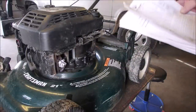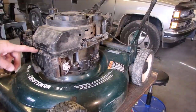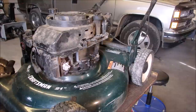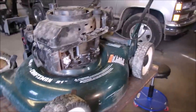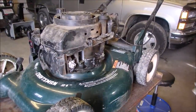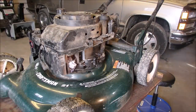I took the cover off to get the model number. The model is 12H802 and the year is 2000, May 26th — that's on the code list right there. Tecumsehs are harder to find the date. On this one, as per the check chart — it's very hard to read — exhaust is 9 and intake is 7.